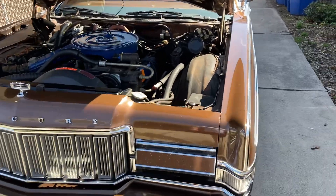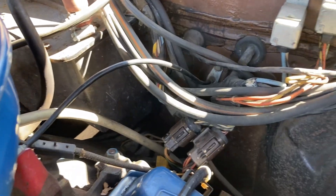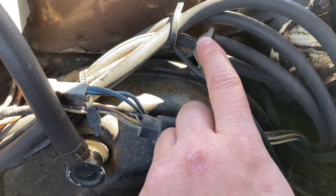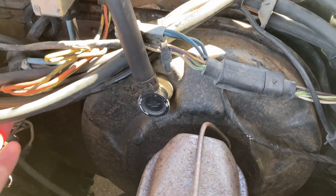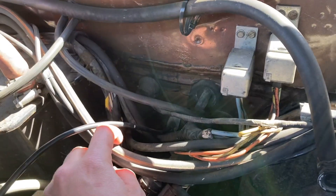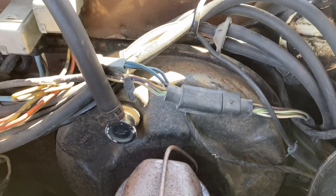When you get new headlight motors or NOS ones, you also want to make sure to replace your check valves — there's one there. Usually these AC cars have more than one, so we'll have to check all the different lines going from the vacuum. It's also a good idea to replace those, as they tend to go as well.